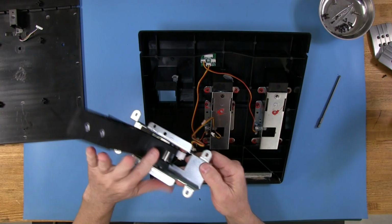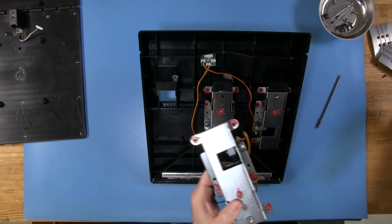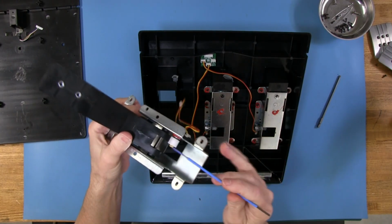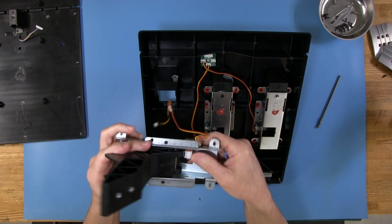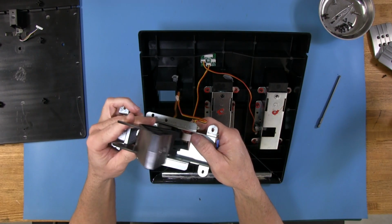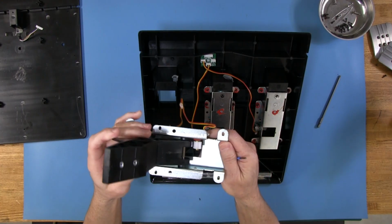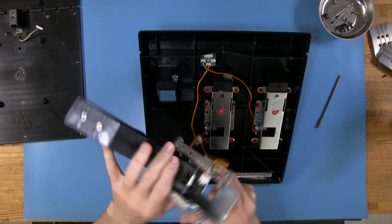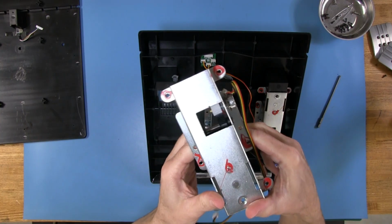But we'll also take a look at how this is working. That's probably a better view on the bottom here, but it's hard to get the light in there. You've got some teeth over here. Let me point, get my fat finger out of the way. You can see this gear right here is actually on the potentiometer. And there's another gear. In fact, I'm just going to take this loose. You don't want to do this without paying attention to where these gears are interfacing, because you want to get it back to the same place once you have them disengaged. So I'm going to tilt this pedal lever all the way back, and then spin that gear all the way back as far as it'll go. That's the limit of the potentiometer inside. Now I can take this pedal interface and move it so you can see the gears better. And there they are. Once this is engaged, I'll push it down a little bit so they can mesh again. And there they go. That's how it's turning the potentiometer when the pedal's working.